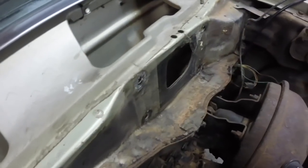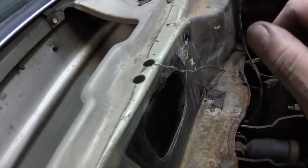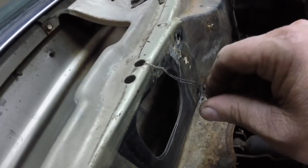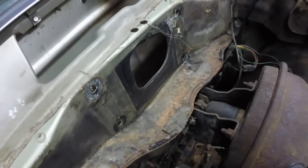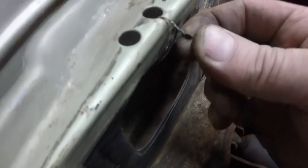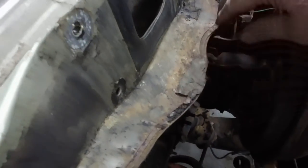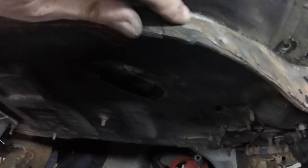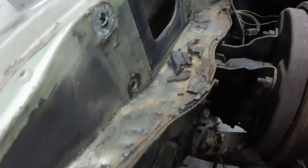The wiper motor is off. I find these little wires that have green paint on them, so there must have been a tag on that at one time. I found two or three of them throughout the engine compartment, and when I see paint on them that tells me they were on there before the body went through the paint booth. I've got to replace the seam sealer — this stuff here just pulls right out; it's completely dried out. I've got to clean this all out and re-caulk it, because if you don't, that'll leak water in there.